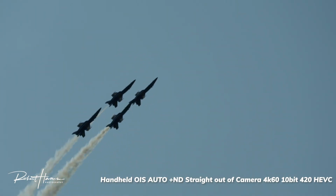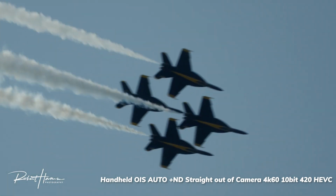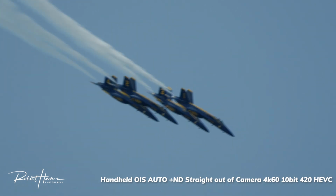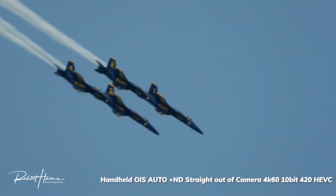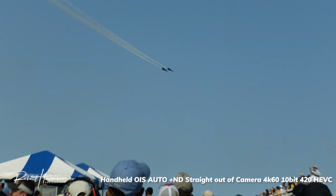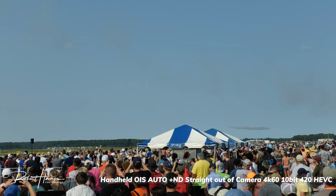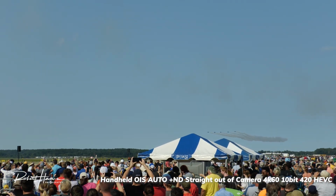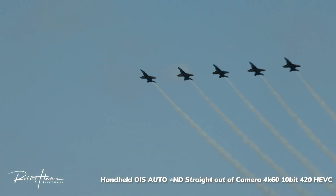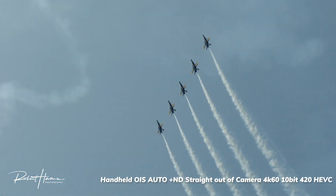In any event, if you're not satisfied with that, because that's close, that's the one I believe it is, that's why I brought it in here, but I also think that it could be the IMX 383. And this one's going to help you a little bit differently. This is a true 1-inch sensor that has multiple different modes. And in this instance, if they're using this sensor, I believe they're using the type 1/1.06 inch sensor at a native resolution in that readout mode of 17.25 megapixels, but once again brought down to 16.84 when they're using their actual readout modes 1 and 2. Those are the two modes where I believe you'd be seeing the electronic image stabilization or the cropping of that advanced OIS Plus.